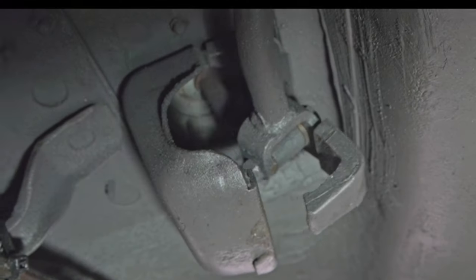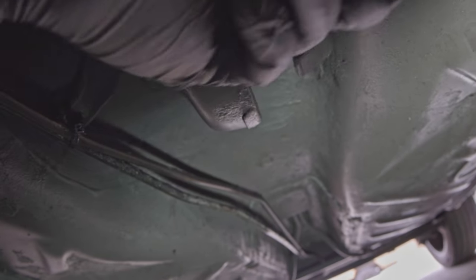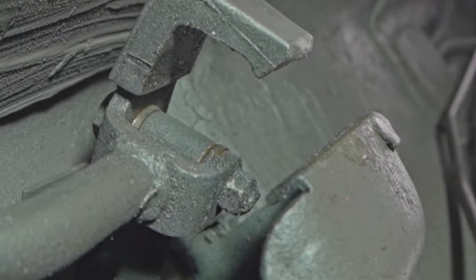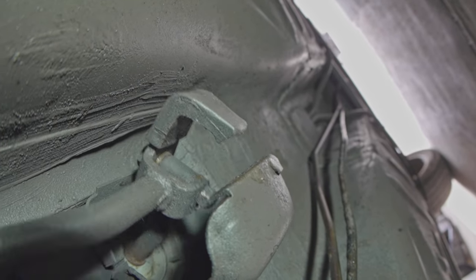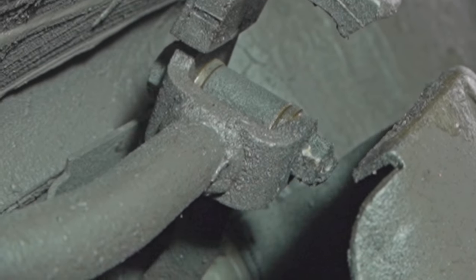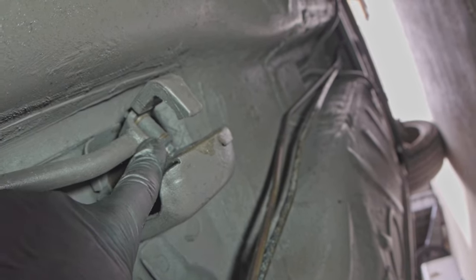We're under the car now. I'm able to translate this linkage without it rotating — this is what it should do; it should rotate. But you can actually see there's slop, so it's not rotating the way it should. If a u-joint like this isn't rotating and has this much play in it, something is wrong. You can even see it shift angularly side to side. I'm gonna go ahead and get this thing out. I'm not really concerned about the yoke part — I'm concerned about this part here in the center, that barrel. That's our problem for sure.